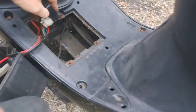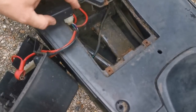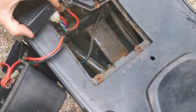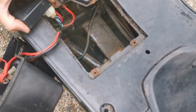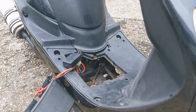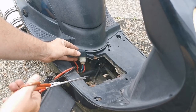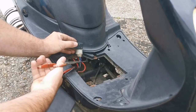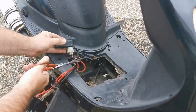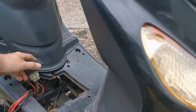So we pop it out. Apparently this purple wire here is the only thing restricting this bike. I'm highly doubtful, but I'm going to cut it — that's all I'm going to do — cut it twice to make sure it doesn't touch itself inside when we're riding, and then connect it back up. You don't need to worry too much about the wiring because if this bike didn't start, or it was the wrong wire for any reason, all you have to do is leave yourself enough so that you can wire it back together. So I'm going to cut it quite low down here once, and a tiny bit more so that it doesn't touch when it's back in. You can see that that purple wire is now cut.